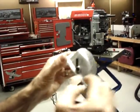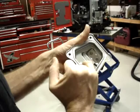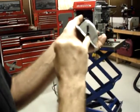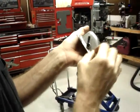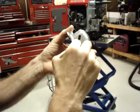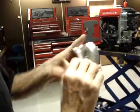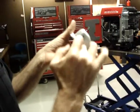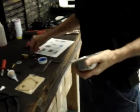The purpose being that there is a certain amount of oil in here. That's why they put this oil return line. And because there is a certain amount of oil in the valve cover, you don't want the oil being pumped out through the pulse line. So when it heads vertically, because the pulse line is actually a positive and negative pressure wave, it will pull almost as much oil back down as it puts up. So as long as it's pointing upward, you've got very little chance of losing oil.